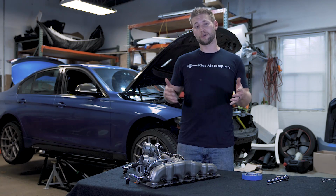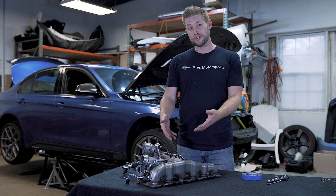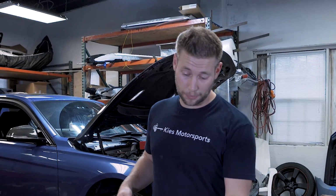So today, what we're going to do is show you how to set a pneumatic wastegate on an N55 turbo. Specifically, we're doing this on a Pure Stage 2. Now, if you have a manual wastegate or a pneumatic wastegate like we have here today, this is a manual process. You're going to need a little pump. It looks just like this. This is a Mightyvac. We'll have a link in the description.